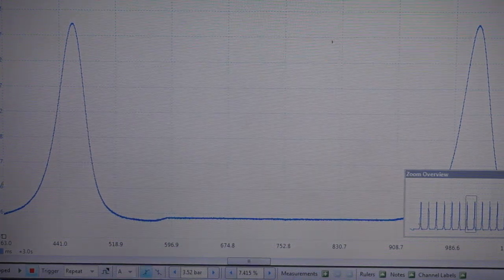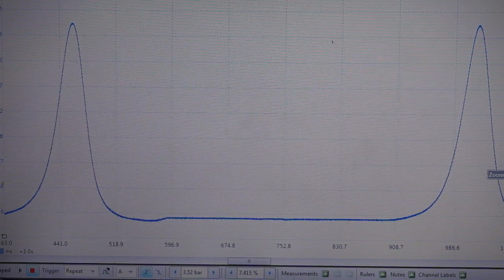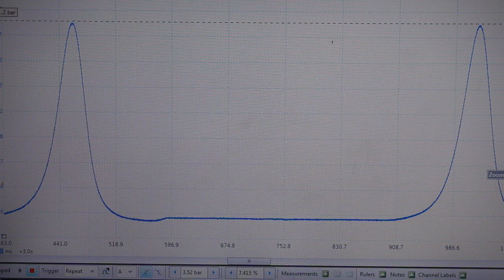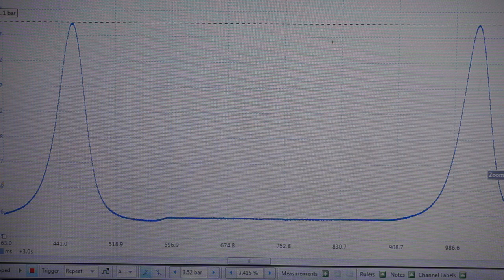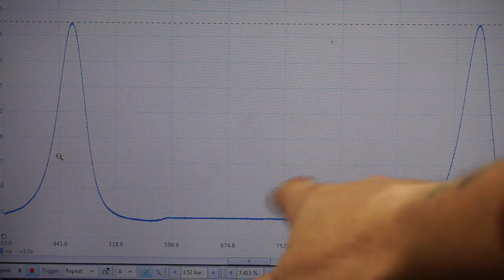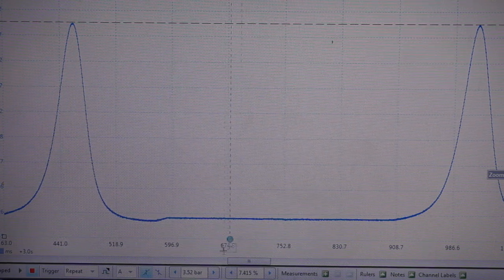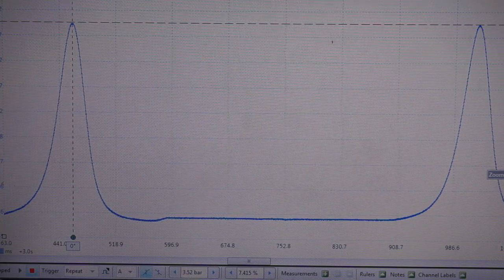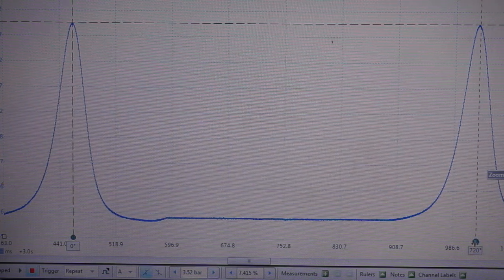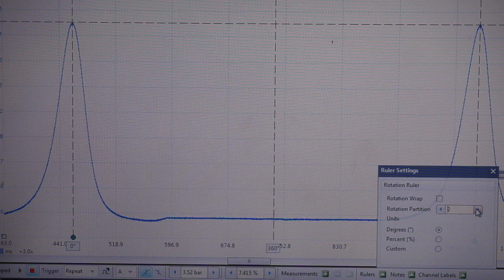Now that's what an in-cylinder waveform on a diesel engine should look like when the timing's right. And if you look now also as well, compression is now at 21 bar, they were in the mid-teens I believe last time. Nothing going on around here when the exhaust valves were opening. What I'll do is I will put both traces side by side in the video so you can see the difference.